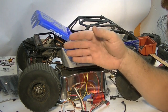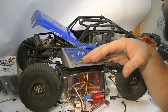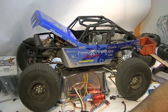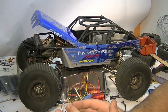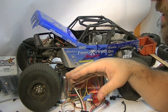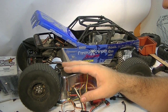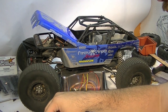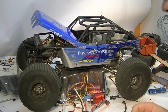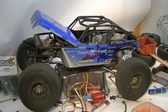I've run a lot of brushless motors in these trucks, from 2000 to 4000 kV — the 10.5 to 21.5 range as far as in-runners go. I've run outrunners as well, and I've run sensored and sensorless. As far as choosing a motor, sensorless — just take that off the table right away. The Castle short course systems or anything like that are not an option. I've run them on the rocks; they're just useless.